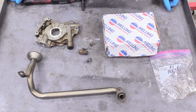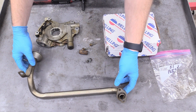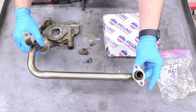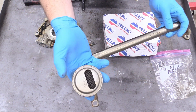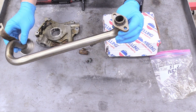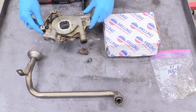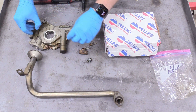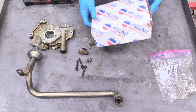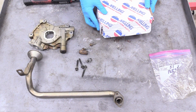Let's jump in and worry about our oiling system. The stock pickup tube is cleaned out — I sprayed the inside thoroughly with carb spray and compressed air, checked the screen, and it's basically a new part ready to go back in. This is our stock oil pump — this is totally junk, throw it in the trash. The only thing you're going to save are the bolts.